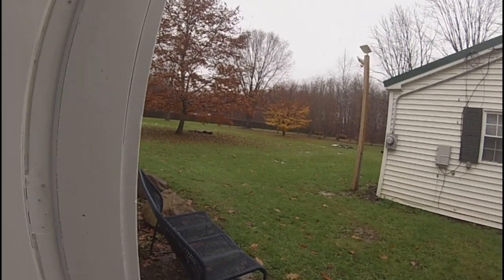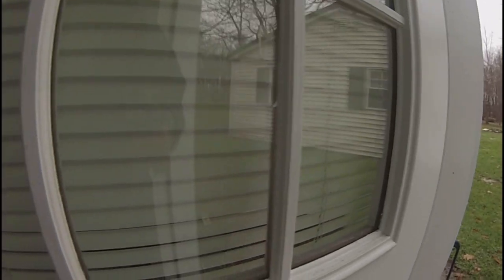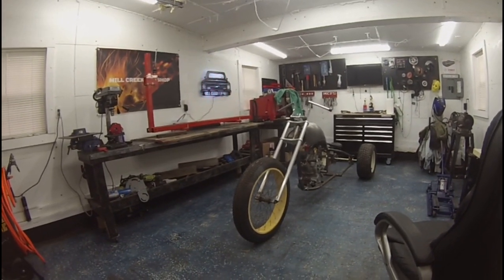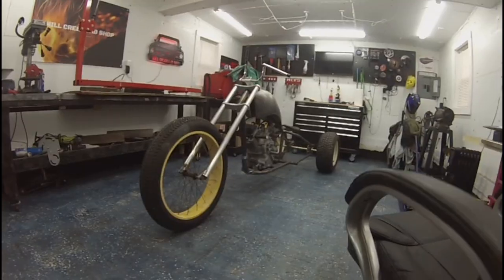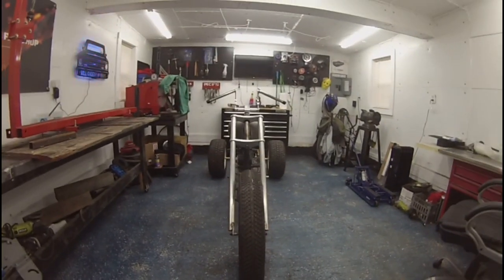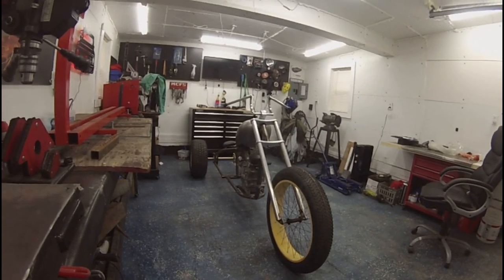Oh man, we got rain y'all. Anyway, today is November 21st, 2021 — we ain't here to look at the rain though. I want to show you something — look at that. That is Trikezilla back on the ground after making some modifications to the frame to fit that Kohler V-twin in there. The frame used to be slanted — those bottom tubes used to be slanted up higher by five degrees. I cut those, lowered it, had to extend the down tube, and now we got the fat front wheel mocked up on here. Oh my god, makes such a huge improvement on this thing.